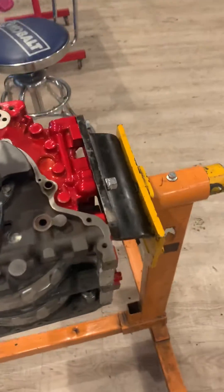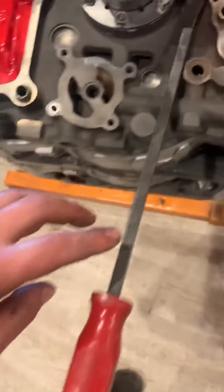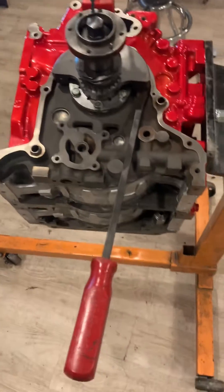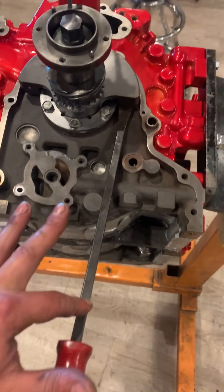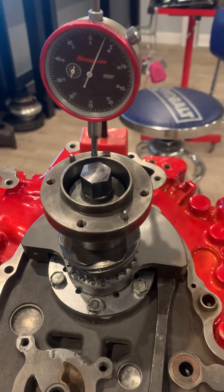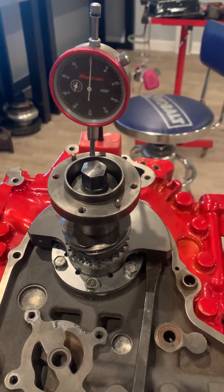If you don't want to push up on it, literally just put a small pry bar into the little dimple here in the casting. Do not force this — that is not going to give you an adequate reading. All you have to do is one finger. All you're looking for is that little gentle play. Don't force it. That's what you're reading for. So that's three thousandths — it's perfect.